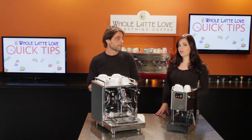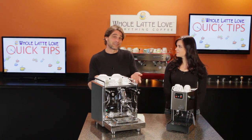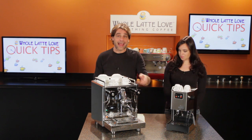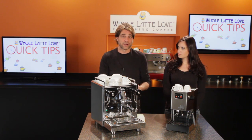Now, there's a ready indicator light that's going to let you know when your boiler's up to temp, but that doesn't necessarily mean that all components of your machine are up to temperature. Right, so when that light comes on, you're not necessarily ready to brew because you've got a lot of other heavy metal components that need to heat up first. Otherwise, the water's just going to get cooled down when you go to brew.